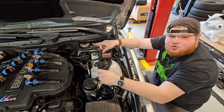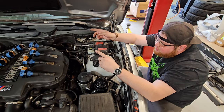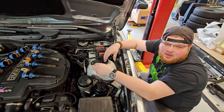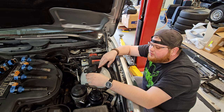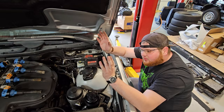I had a situation where my other car was broke because every time I have two cars, they either both work or none of them work. I had to drive this one to work a couple of times with the vanos on that side not working. I essentially just unplugged it and let it run in a base map, which was horrible on the cats and horrible on the plugs, and it would misfire once in a while. I babied it to work a few times until I could get the parts — the solenoids on these are soldered to a board. You can only get them used from Dr. Vanos. You can also buy the entire board brand new for $2,100 a side. So I got a used solenoid tested by Dr. Vanos. It essentially wrecked bank one, so that's really the reason why I wanted to do the plugs.